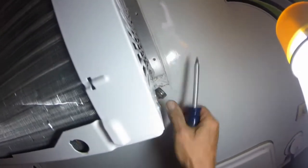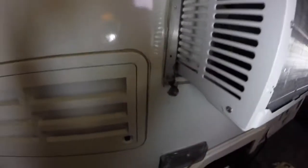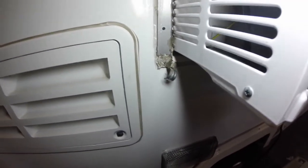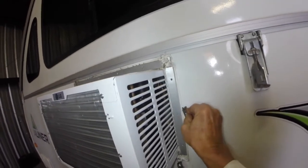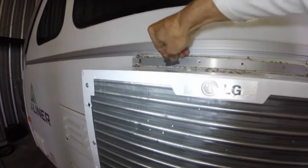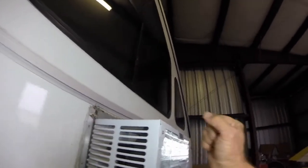I found you can see these are loose — I dug away and you can see the screws coming out for your tie downs. There's one on each side; this one's still full of gunk. Dig around with a razor blade to get it out, then take your razor blade and cut right along here on the bottom, cut here, and cut everywhere. Also on the inside there's clear silicone you can cut. Once all the rivets are out it's still not budging — it's in there well, it's sealed up. Just cut and slowly wiggle it — it'll loosen up little by little.